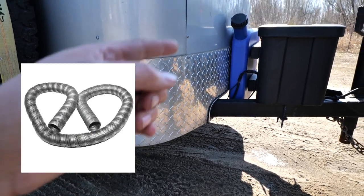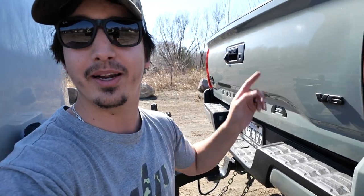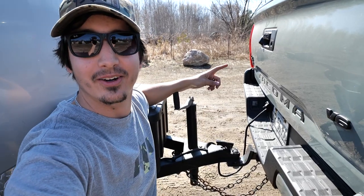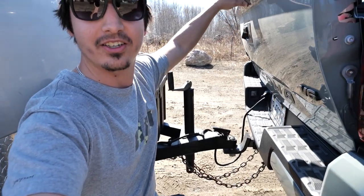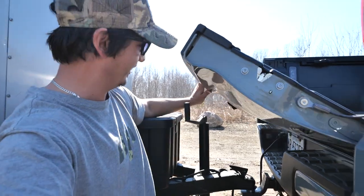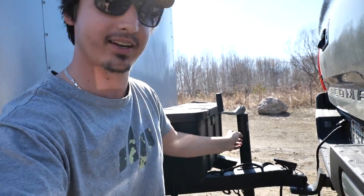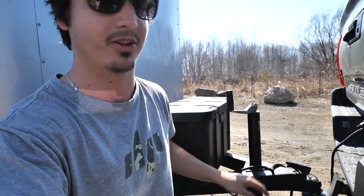The upgrades I recommend for the diesel heater are the exhaust, the fuel tank, and the intake hose. It's a UV-rated 10-liter fuel tank that's holding up a lot better — the original cracked right down the seam in under five months. The diesel heater itself is quite good, but all the external components I suggest upgrading. I also almost destroyed my brand new tailgate with this new truck, because the tongue on the trailer is so short that the tailgate hits the jack — so I need to replace it with a swivel mount or something lower.